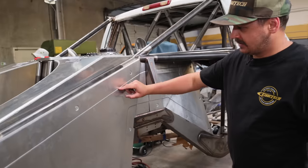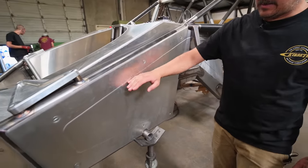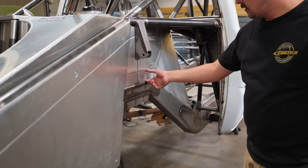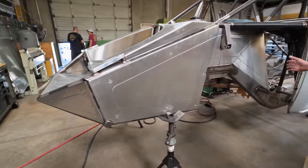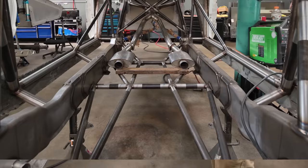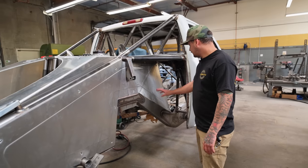On the back here on Dan's truck you see a bunch of aluminum panels done. I'm very particular about how I like my aluminum panels — I don't like bead rolls too close to the edge, I don't like the bead roll facing in. I like to step the center of the panels out, and I don't like doing a bunch of jogs around the buttons with bubbles and shapes everywhere. It's pretty much four inches all the way around the perimeter — gets a little tighter in one spot to about three inches, then back to four all the way around. I don't want to overdo the panels; I want everything to flow seamlessly from front to back. Even the stock frame — we welded all the factory holes shut and blended the frame so it's just one seamless frame rail.